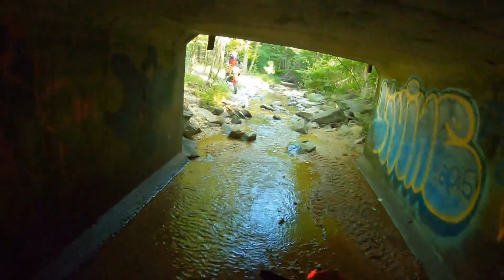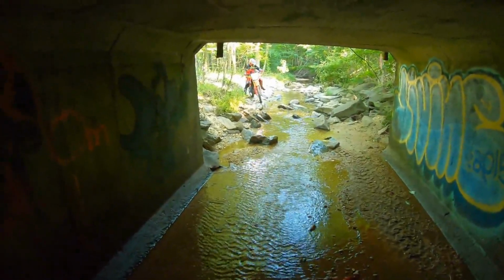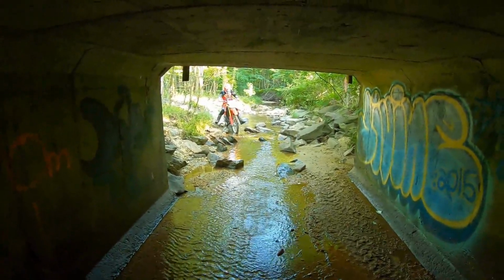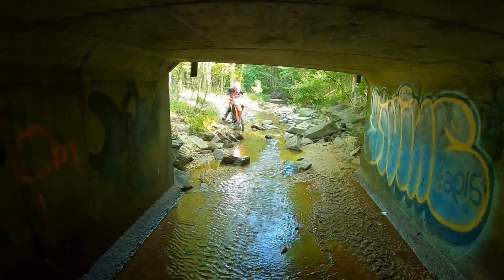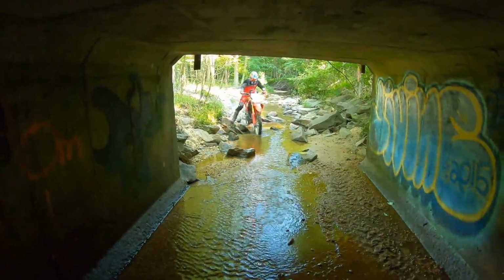And anybody that knows how that one-way clutch works for the starter, when the motor kicks back, because the clutch only spins one way, and if that thing turns backward, the only thing it can do is turn the starter motor backward. Tire working out. Yeah. Cool. He's got that Tusk D Sport tire. It's very similar to the D606. Works pretty good for him.